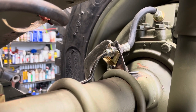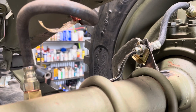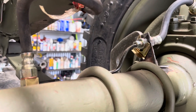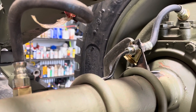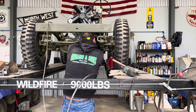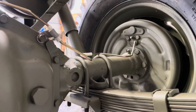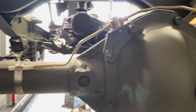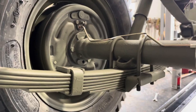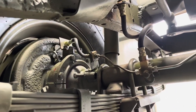Working on the brake lines now. Since I'm kind of doing a World War II tribute Jeep, I made some little brackets to hold the brake lines just like the World War II Jeeps had. The brake lines are run just like a World War II Jeep would have had them, except of course with 11-inch brakes. I had to weld a couple of brackets to mount the brake system to the front axle.